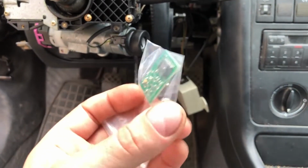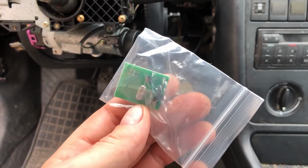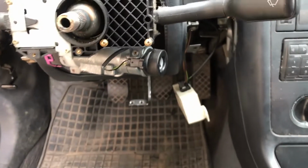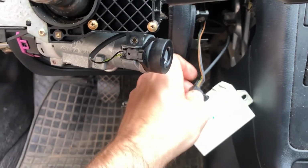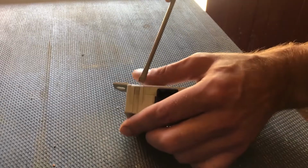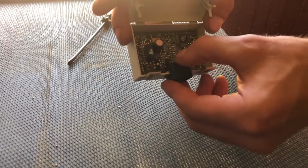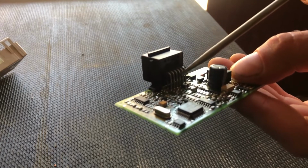This is an immobilizer emulator, which can be purchased using the link down in the description. In order to install the emulator, we'll need to do some soldering. So first of all, let's unplug the original control block. It's not that easy to do with one hand. Let's open the box. Pull out the chip. We'll need to cut off these connections, because this is where we're going to solder the emulator.